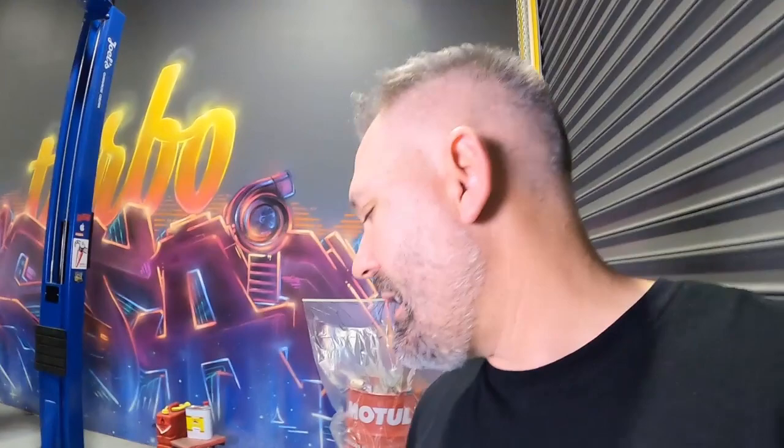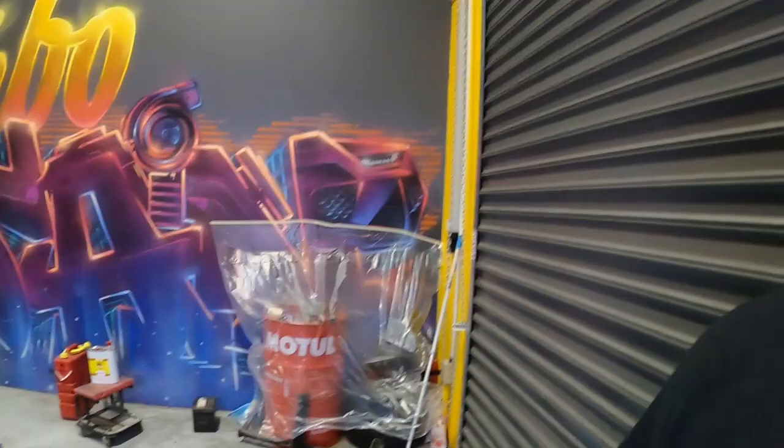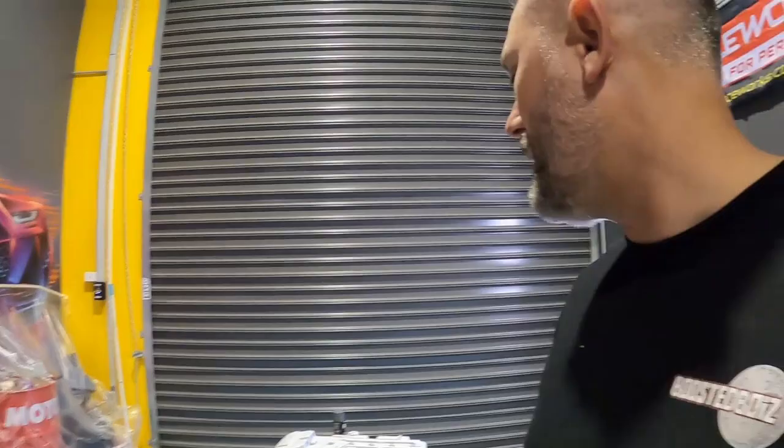So another wash with water and then another wash with the prep wash. Then you heat it up, dry it all down, get everything good to go. Once it's warm to touch, there's no more water spots, there's no fur or hair or anything on there, and the wax and grease remover has done its job, then you can move on to painting.